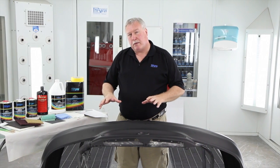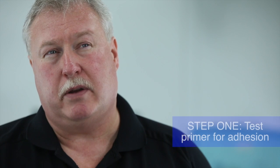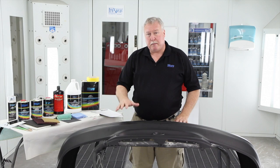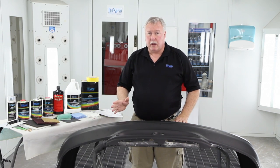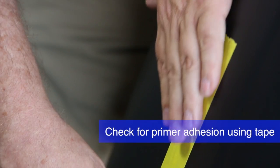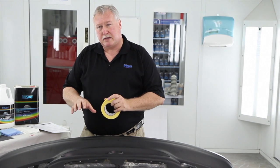We still want to wash this bumper cover very, very well, but before we do that, since this is primed, we want to make sure that we have good adhesion — because if this primer doesn't stick to the plastic, the paint may stick to the primer but it could still peel off. Take some tape, put it on the bumper cover, rub it down real good, and pull it off to make sure the primer is still adhered to the plastic cover.